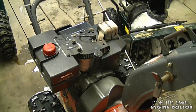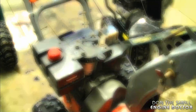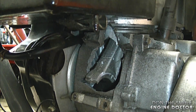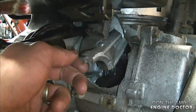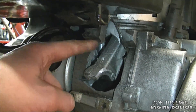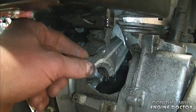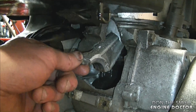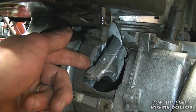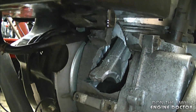What I have here is a blower that just came in and I'm going to show you what happens when it comes to engine over-revs. Take a look at this — this is where the electric starter used to go, and you can see the rod came right through the engine. That block is very damaged. If it were a tiny little hole sometimes people can fix them, but in this case the block is done and the engine as well. There may be some salvageable parts inside but it'll have to be taken apart first.